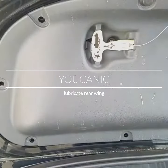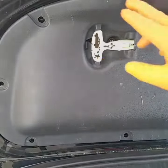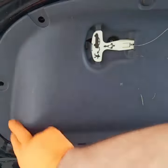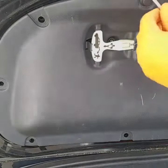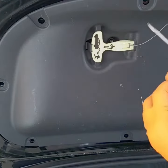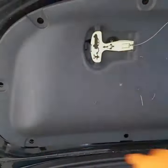Remove the plastic cover of the bottom part of the trunk lid — it has several plastic retaining pins. You can remove them just using a flat screwdriver, just pry them out, then remove the centerpiece. They can just come out all at once.